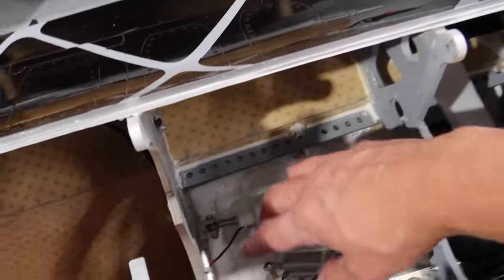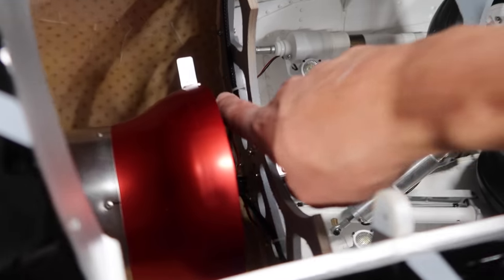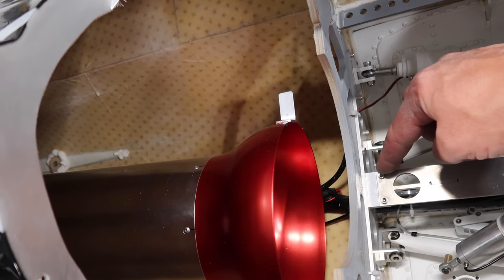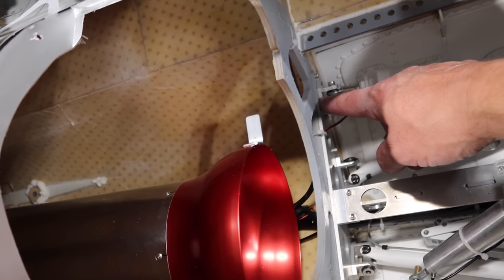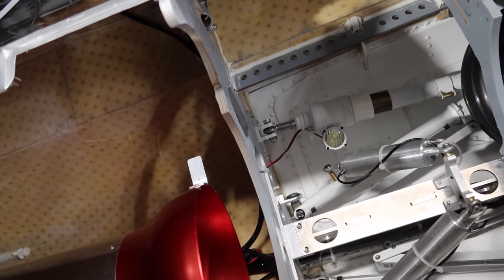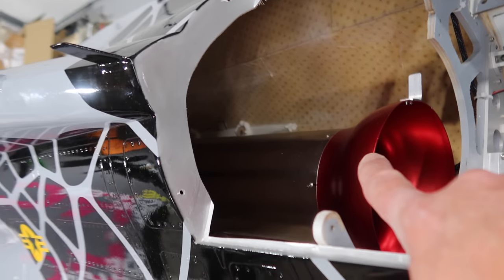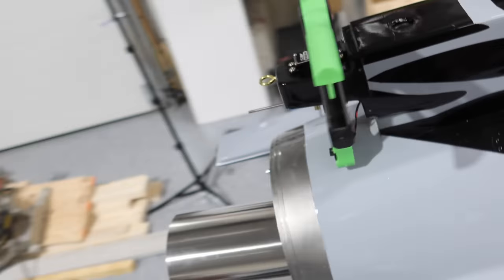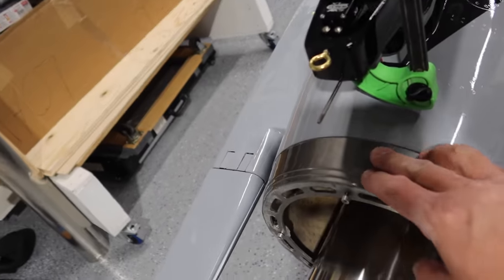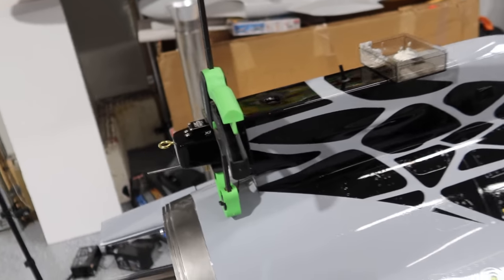So final steps on the landing gear here. We did all of our back bolts — most of those are lock nuts from the back side and every single one was very loose. The four pairs right here you have to access from the back side, so we took those straight out, lock-tighted them, and put them back in. The entire gear setup is now 100% complete and all lock-tighted. In preparation I put the pipe back in — we're not ready to put the pipe in the aircraft, but at least it's in there. This is the last portion tonight — it's about 11:30 — we're going to let this cure overnight and continue on with our mechanism for our chute tomorrow.